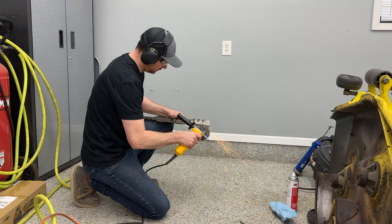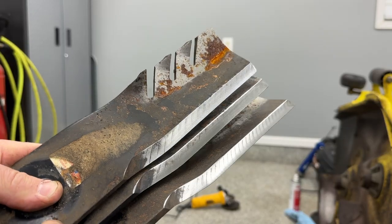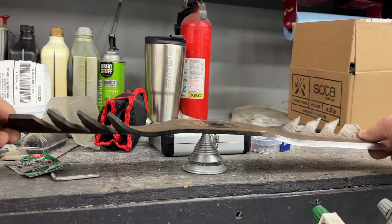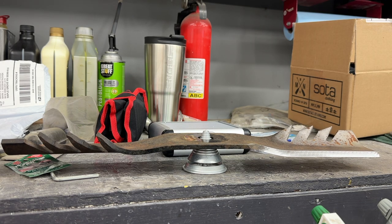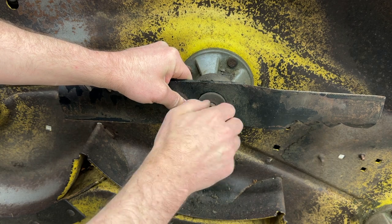I'm going to be using an electric grinder with a flap disc to sharpen my blades. Don't skimp on safety gear — glasses and hearing protection are must-haves. I run the disc in a back and forth motion across the blades. My blades were fairly new since I replaced them halfway through last summer, so they really weren't too bad — you can actually see the factory tooling marks on them, so I'm not taking off much material. Either way, I like to throw them on the balancer to make sure nothing's too off kilter, since a misbalanced blade can lead to premature spindle failure and vibration. With all three blades sharpened and balanced, a couple of ugga-duggas with the impact and all blades are back onto the mower deck.